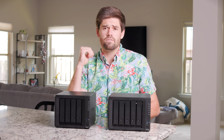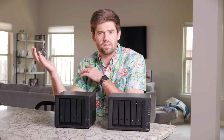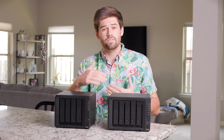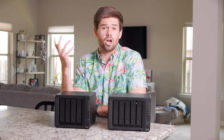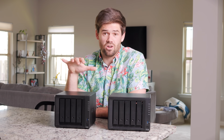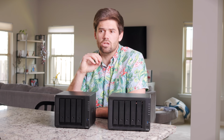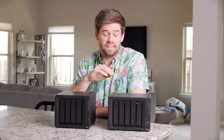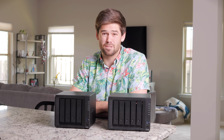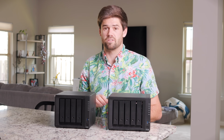It's also going to give the ability to hop on different VLANs. And so you can have a security camera VLAN, you can have a storage VLAN, and you can have a bunch of different VLANs all being able to pipe into this. Synology is not great about having multiple VLANs on a single NIC. And so having the ability to have 4 different LANs is really, really nice. Especially if you're a bit more of a power user, that's well worth the upgrade in some specific users. Though I will say the majority of users, 2 ports is enough.